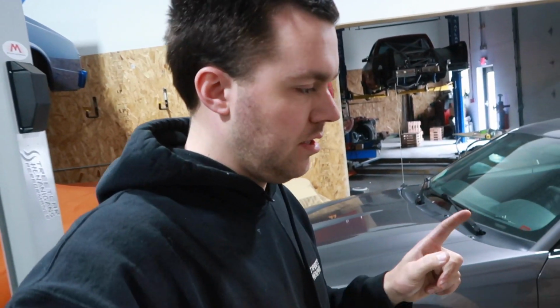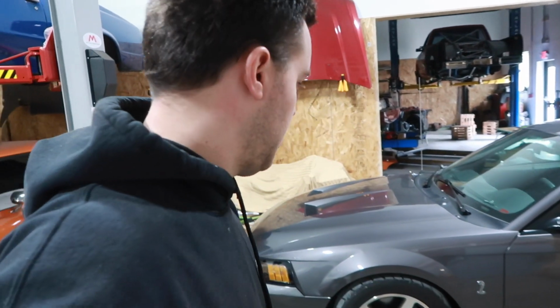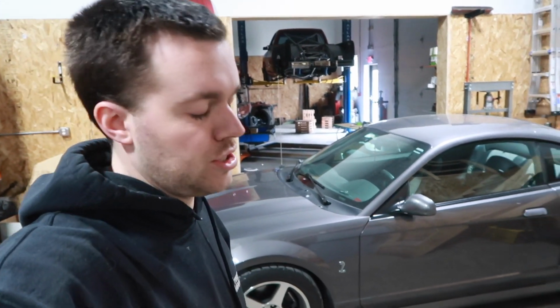And I have a feeling that some of you guys, or the people who are having these clutch failures, have that same problem. They let it ride, because it obviously works just fine. But it's not 100% engaged when you think it is, and you end up blowing through it, especially on break-in when they're not really worn in. Even the red VMP car that we have here, the clutch is not broken in all the way. I know it's already been on the dyno a handful of times, it's already gotten its ass kicked a few times, but you could see on the clutch material that it has points that have not made contact with the pressure plate and the flywheel yet, meaning that it has not been properly broken in, or it does not have enough miles on it.